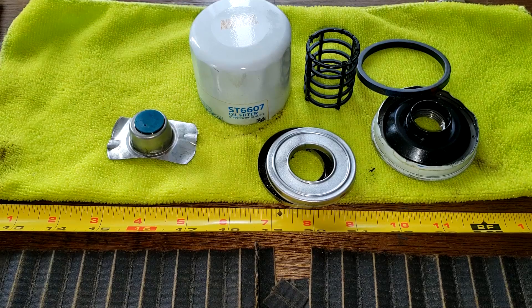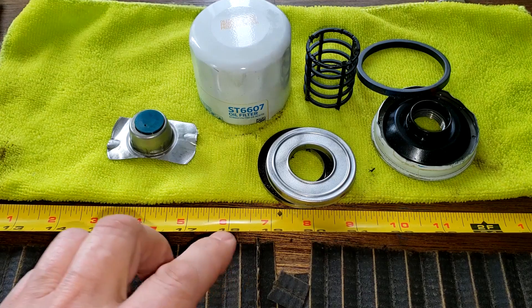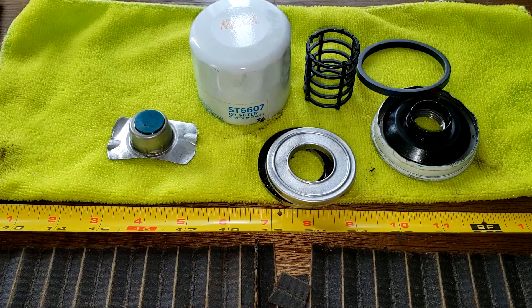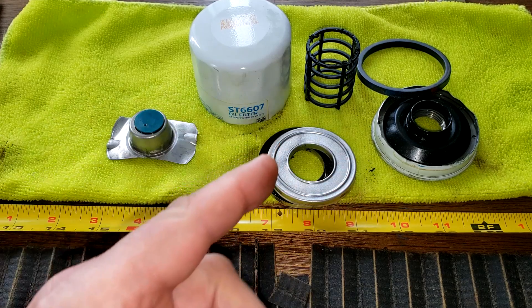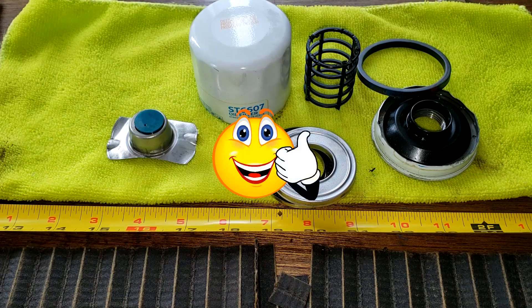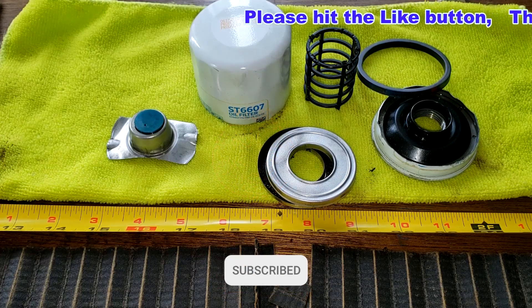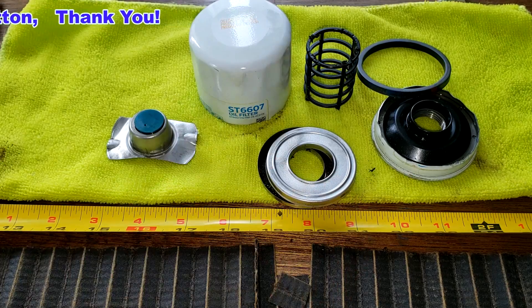I'd say the oil did a good job, and the filter caught a lot of soot and carbon inside the filter itself. Ken put 9,000 miles on this filter, but I don't think I'd push it any further than that. If you have a dirtier engine, it might start sludging. He has a newer vehicle with only 63,000 miles, so it's still running nice and clean. For a $4 filter, it did a pretty good job. What do you guys think about this filter? I want to thank Ken for sending me this used Supertech oil filter. Don't forget — Oil Filter Fridays — I try to open up an oil filter every Friday on this YouTube channel. If you like this video, please hit that like button. Thanks for watching and take care.